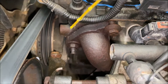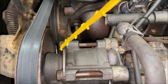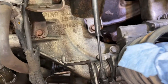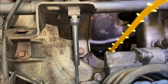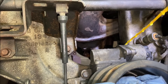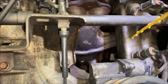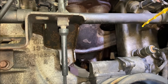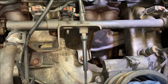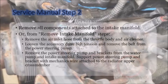You also want to hit everything else you're going to be touching. I don't know the last time the belt's been removed on this Jeep, so hit the tensioner bolt, the steering pump bolts, the bracket bolts and nuts, the throttle body, and there are two 10mm bolts that hold fuel lines on the bottom of the intake manifold that you should hit from the bottom. Also hit the nuts on the exhaust connection to the bottom of the manifold. Then step one: disconnect the battery negative cable.